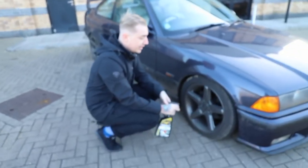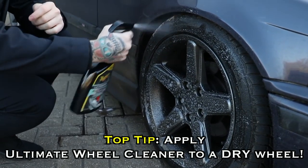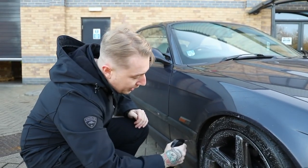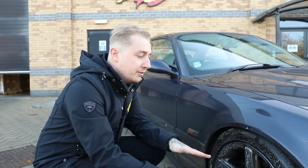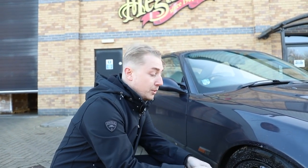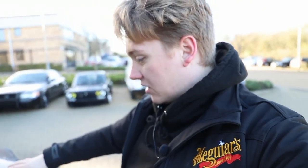Little checkpoint one: there's a system to putting on wheel cleaner — start from the bottom, work your way up to the top. And just to stress again, this is a pH balanced product, so it's not an acid cleaner. Just get a nice even spray everywhere. Once you've got good coverage, get on the tyre as well, then you can work around the awkward bits. Because it is a gel, just let this dwell for a few minutes. We're going to jet wash it down to see if we can get it off without agitating. If you've got real hardened grime, you might need a soft nylon brush or a wash mitt with some soapy water to really get in there. But because these wheels are recently painted, I think the wheel cleaner is going to be fine to completely remove that dirt and grime. When the wheel cleaner starts to work, all the runs and foam starts to go purple — that's how you know the product is reacting with the dirt and grime on the wheel and tyres.